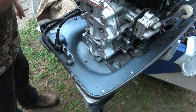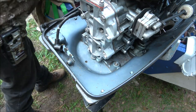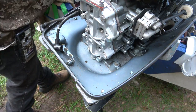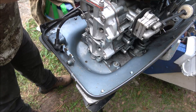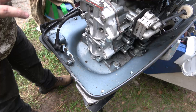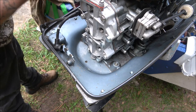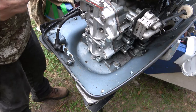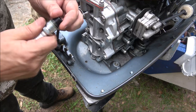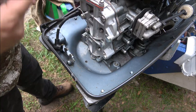I'm going to get some air to blow this out, then get my Loctite and show you how we're going to put the insert in. Now, before I put this in there, I'm going to put some grease on the threads of my spark plug — and I'll explain why in a second. That's in case I happen to get any of this thread locker on these threads — the grease won't let it lock.